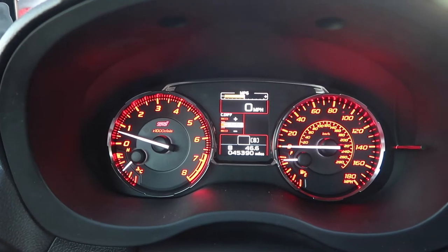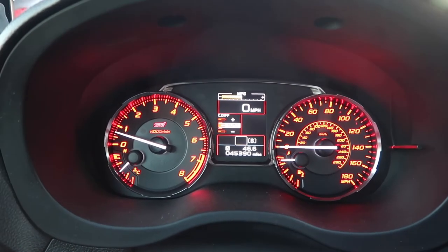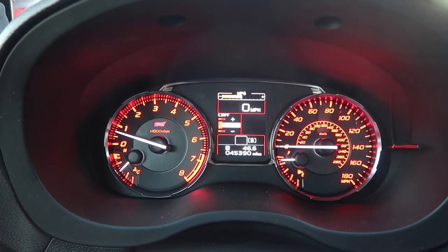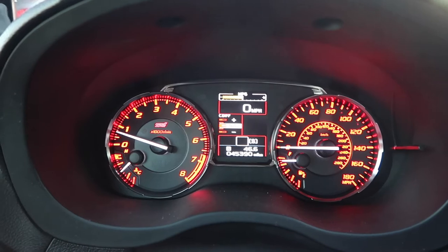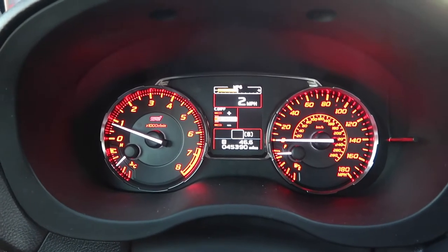Here's how it looks — moving the car with just the friction point of the clutch, no gas. The car is going to slowly, slowly start moving by itself. As long as you let the clutch out slow, it's not going to stall. Practice, practice, practice when it comes to that friction point and learning it.